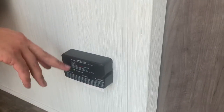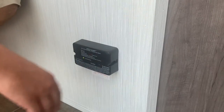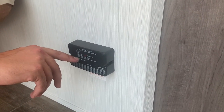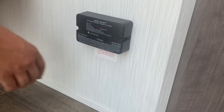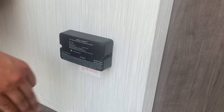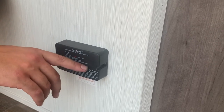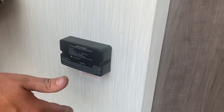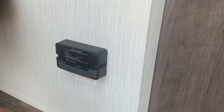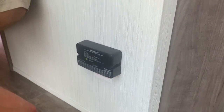Right down here, below all those controls, you have a hardwired carbon monoxide and propane gas alarm — it functions for both. It's got a sensor right here pulling air through it all the time. If you get carbon monoxide or propane in here, lights right here will flash different combinations, and there's an index telling you what the different color combinations mean. You also have a test/mute button. Being a hardwired device, you do not have to replace the batteries — any time you have 12-volt energy in here, this is energized as well. It has a replace-by code and an end-of-life alarm that tells you the sensor is clogged and it's time to replace it. These run about $40 and are usually good for six or seven years.